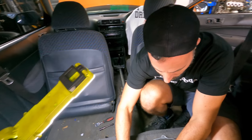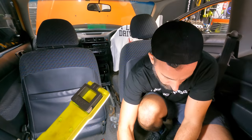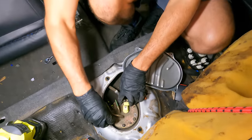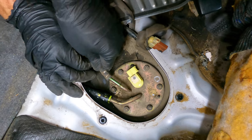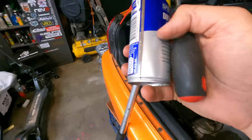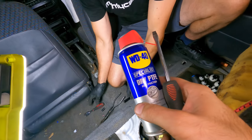It's worth noting this car's probably got really stale fuel in it, so at some stage you may have to drain the tank or flush it through. If this car hasn't moved for years, there's a good chance that stuff in there smells a bit shellac-y. So we'll probably have to drain that out.